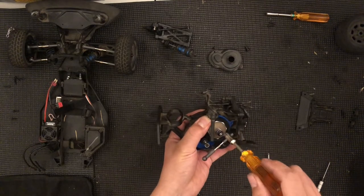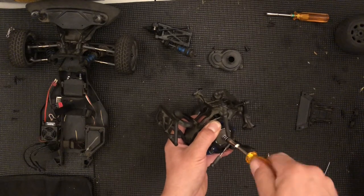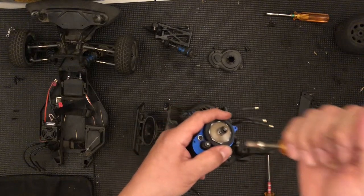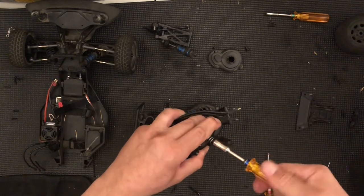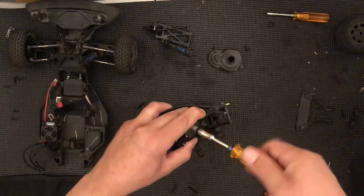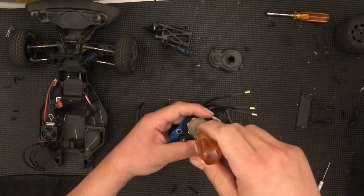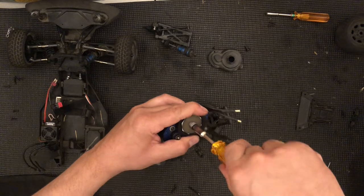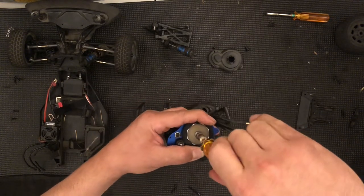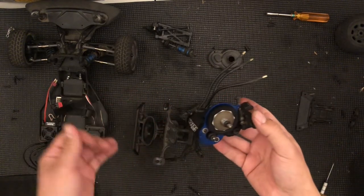For the slipper, I'm holding the gear and tightening all the way in, then moving it back. I'm going to use two fingers. I'm not sure where my friend wants it, so I'll go back one and a half turns — that's half, one, and the half — one and a half tends to be a good starting point. You can loosen or tighten from there.